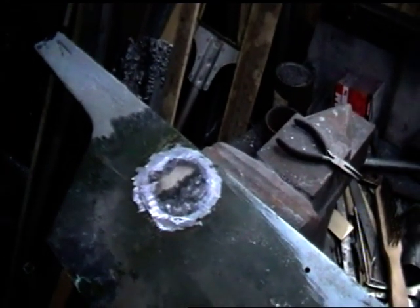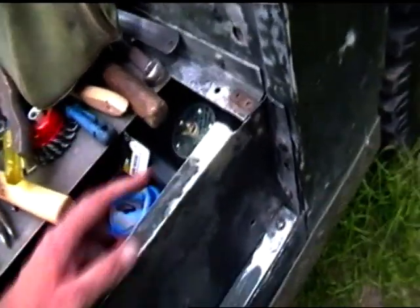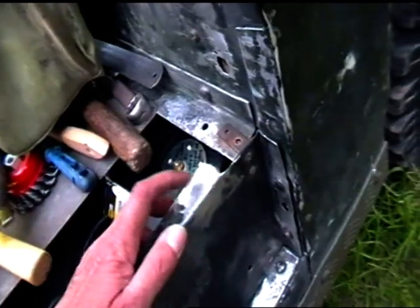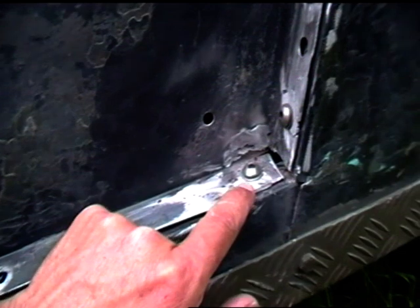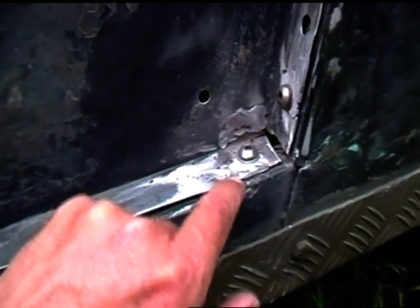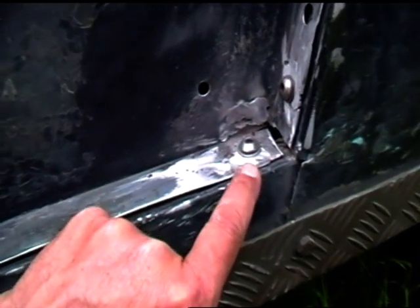So it was a scrap wing with a patched hole. With a bit of work, I've managed to do some repairs on the Land Rover using the same sort of system. I've clamped stainless steel plates behind the aluminium and then welded through. By putting the stainless steel under, I'm able to weld across the top of it, float a weld right across, and bond the aluminium to the other points where it's missing. I've basically been able to fill in quite large gaps in the metalwork by doing this.